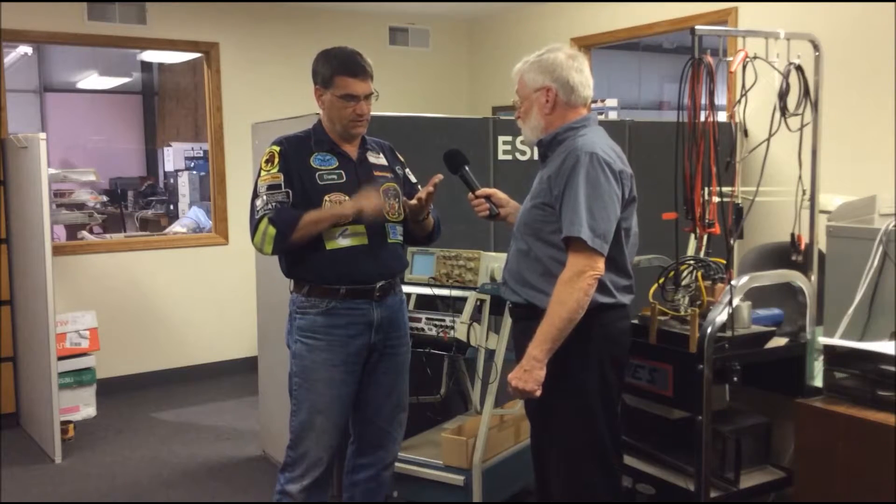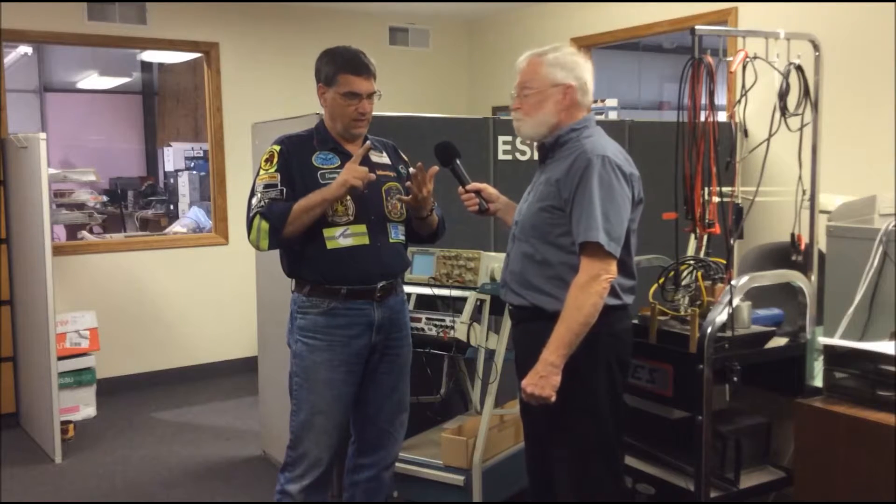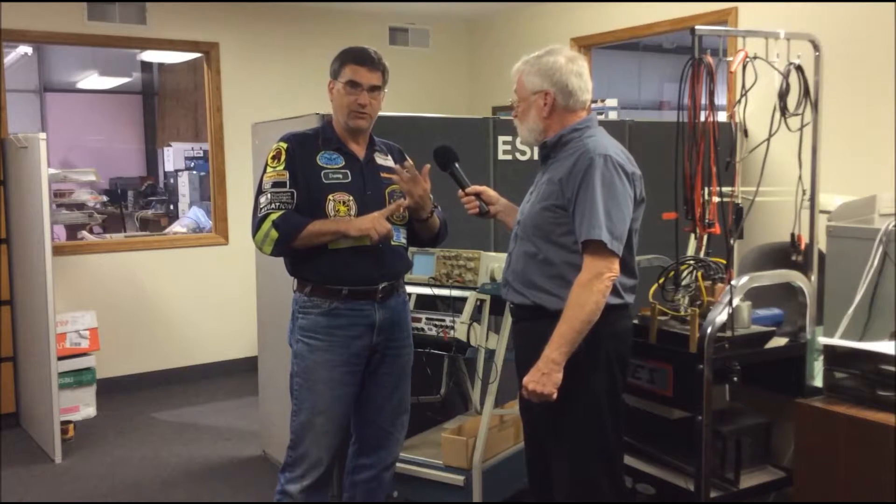The way I teach it is very simple: if you see voltage, you cannot have an open or short. If you don't have an open or short, you've ruled out two-thirds of every possible fault. There are only three fault types: open, short, and high resistance. The only thing the Load Pro does is find high resistance.